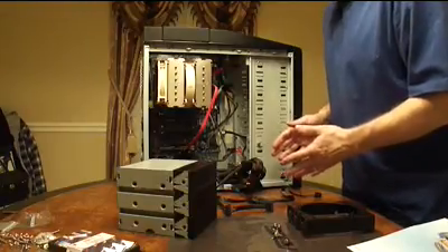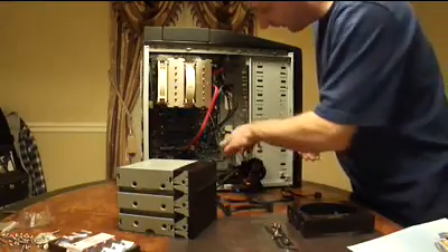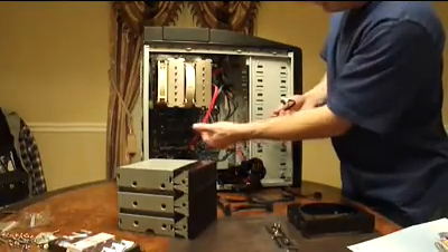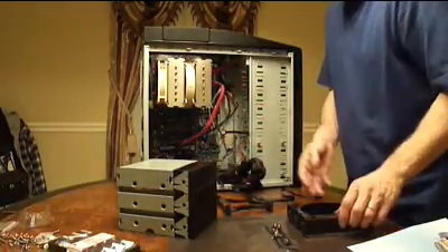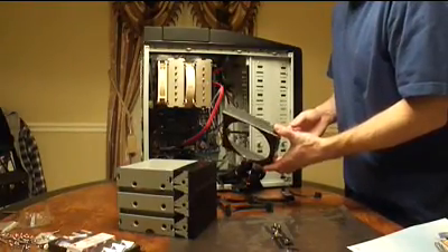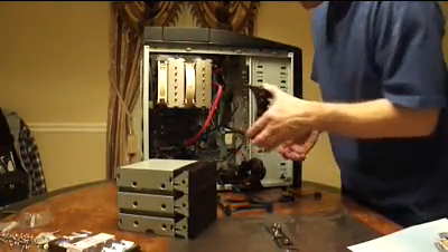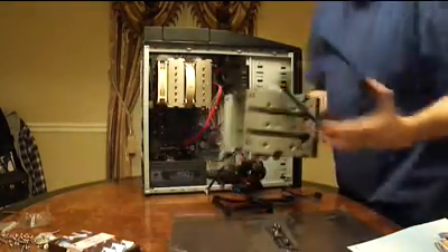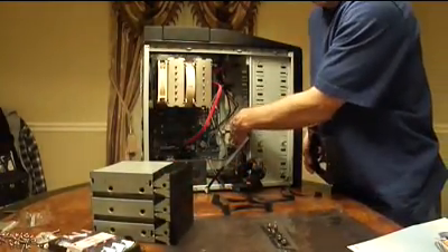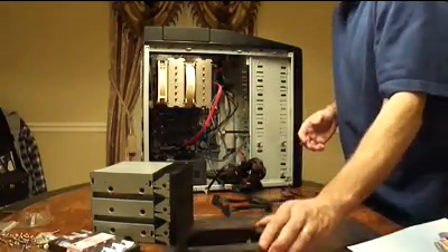We're back with our hard drive in there. I did have to get the 6 gigabit data cable — that came with the motherboard — and make sure it goes to the right port. However, I was hoping to keep the second drive bay's optional mounting fan attached, but with it in there, I wasn't able to get the data cable in — it wasn't happy. So I did have to remove the fan. It wasn't what I was planning on, but that does happen.